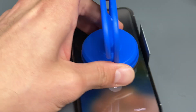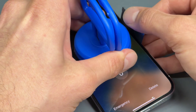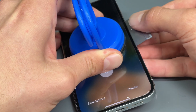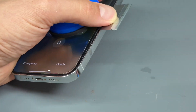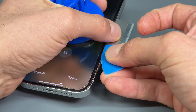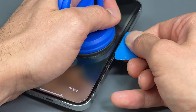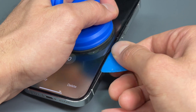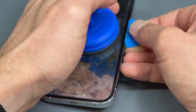Obviously if you can, you need to remove the screws and do this from the bottom. But when you can't, you're going to lift up with the suction cup and pry back with the razor blade until you've got a gap. With that gap, you insert the guitar pick and just run it up in this small area you've created. You can't move it all the way around — you can't go around the bottom or run it down that way.